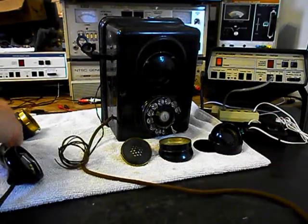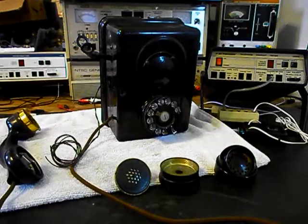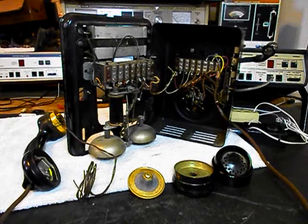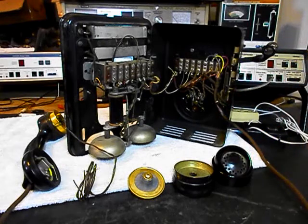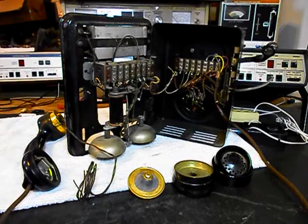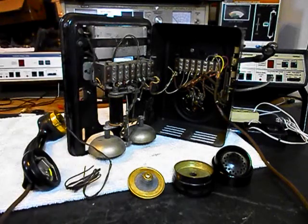Now I want to give you a look at the telephone itself, so we want to open up the unit. Now that we have the unit open, you can see how they designed everything out. We have our rotary, a wiring block, our hook switch, our cradle, our solenoids for the bells, another wiring block, and then a cap. We have a hardwired situation on this telephone — we're going to be removing that.